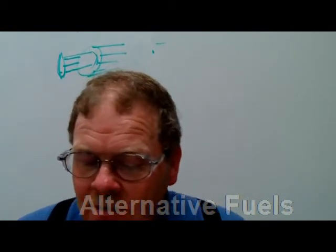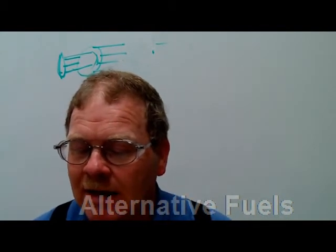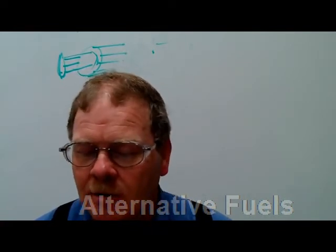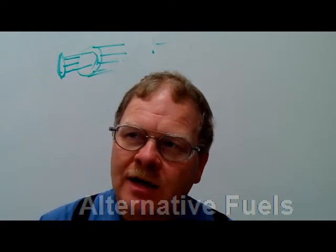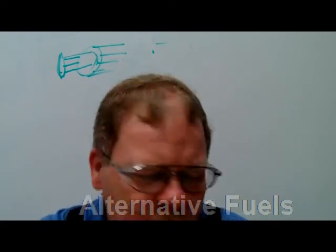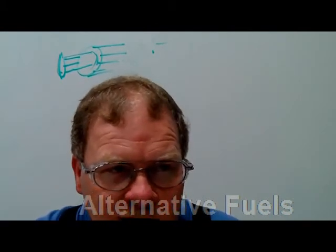Okay. Technician A says that the stoichiometric ratio for gasoline is about 9:1. Is that right? Brandon knows better than that, don't you, Brandon? What is it? 14.7, more or less. Real close, 14.7 is the laboratory figure. If you look at your Chryslers, they'll actually edge above and below that as the emission system optimizes it, but at least that's what we were told at Chrysler School. What does that mean?